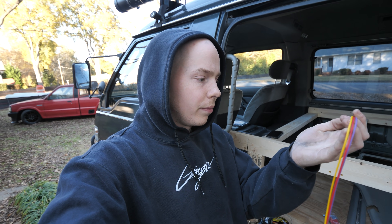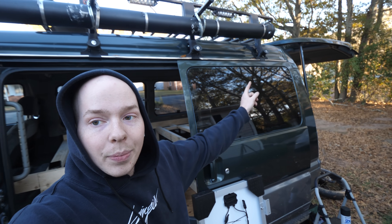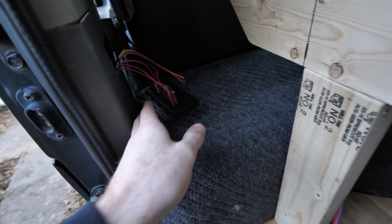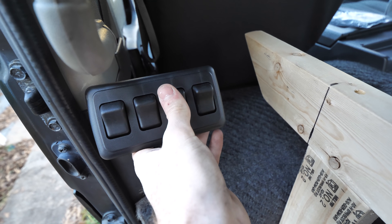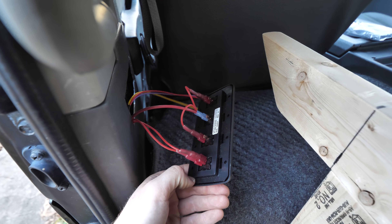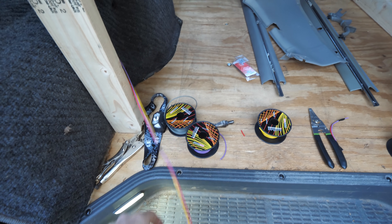While that paint dries, I'm running the wires for the lights. They're going to run along and then kind of up inside the vehicle. The switches for the lights are going to be these three switches — this one turns on those lights, this will turn on the passenger side, this will turn on the back, and this will turn on the driver's side. It already has power coming to it, so all I have to do is route these wires up to the lights and then ground the lights.